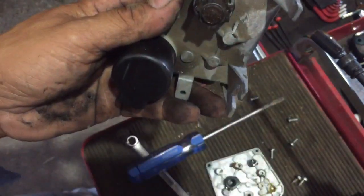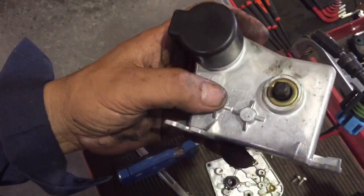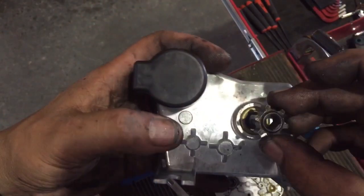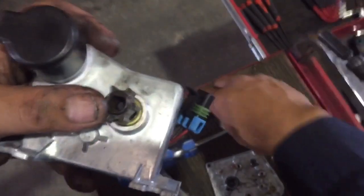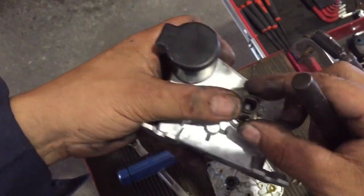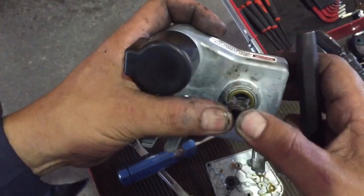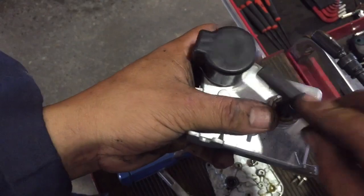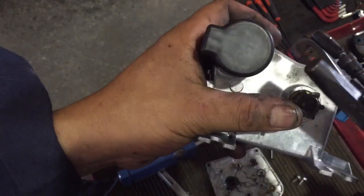I completely dropped the ball on this one — I should have taken the camera and showed you guys how I got this little gear off the old motor. I tore the old motor apart, took the back cover off so you can see the gears, put it flat on a vise, used a pointed chisel on the shaft, and just whacked it toward the inside of the case. This is the gear I wanted to salvage. Sorry about that — if this happens again in the future I'll try to remember to show you guys how to salvage parts off the stop arm before replacing it.